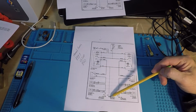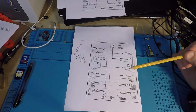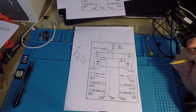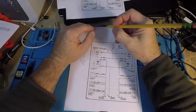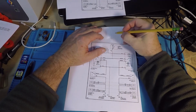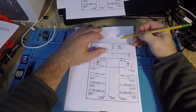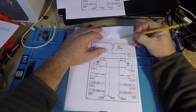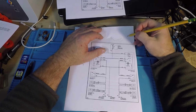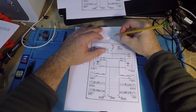So for every light you have to have power and you have to have a ground. It has to have a return loop back to the battery ultimately. The battery is the ultimate source of everything. Let me just write it out like B+, which is for battery. And then it has to come down through a circuit and go through some kind of a load. And within that load it has to return back to the battery negative.